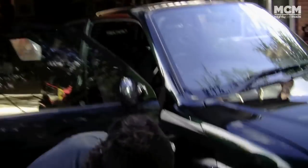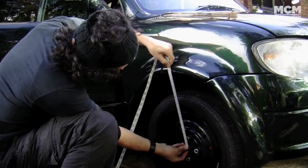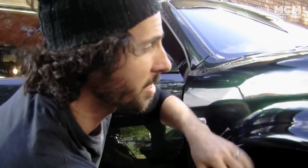You may find different corners of the car have different heights. This car was a courier's van and has 280,000 km on it, so I wouldn't be surprised if the driver's side has dropped more than the passenger side. Measuring from right in the middle up to the guard: 37 centimeters. So this side has actually slumped one centimeter. When we put in the lowered springs, the car's going to sit better all the way around because the springs are new.